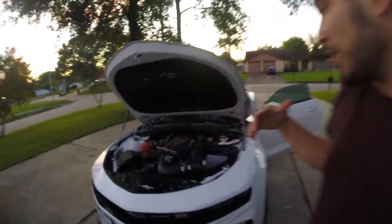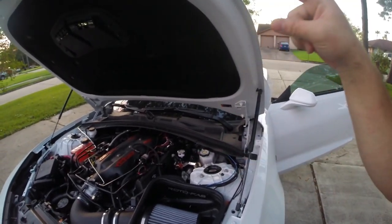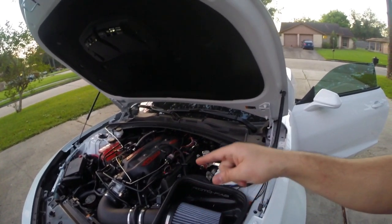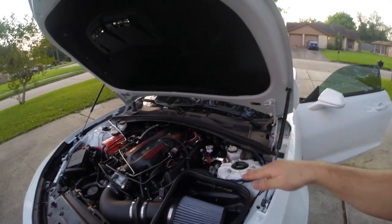I felt the car pull hard and it felt good, but that's probably because I'm not used to this car's power - it has a lot of power naturally aspirated. So we're going to raise the fuel pressure up to 55 PSI and leave it with the 17 fuel jet to give it a little more fuel and see if we can get that air-fuel ratio down. We're running out of daylight, so we'll end it here and catch you in the next episode where we'll try it again with different fuel pressures and go through 50, 100, and 150 shots.